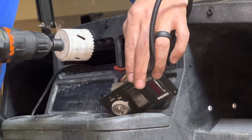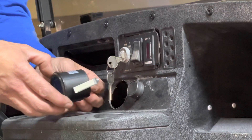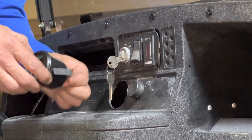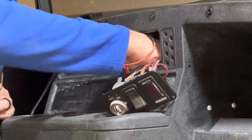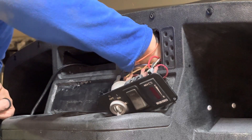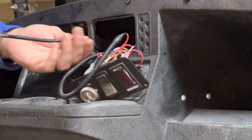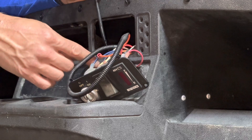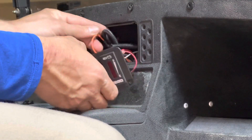Use your 2-and-1/16-inch hole saw to drill your hole where you want to mount your dash-mounted voltage meter. Using the LCD bracket and the hardware, slide the voltage meter into the hole. Once in place, put the bracket over the back and use the provided nuts to secure it to the back of the voltage meter. Pull your voltage meter wiring harness through and plug it into the back — there's a six-pin and a four-pin connector, they only go one way. Zip-tie the excess wire and hide it back up in the dash.